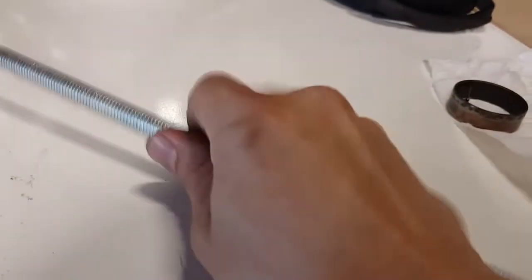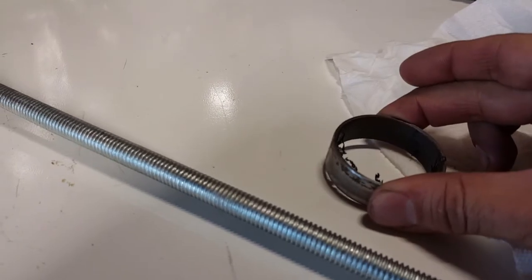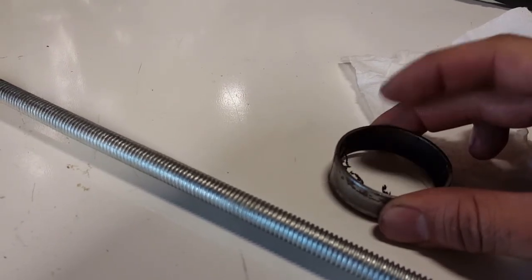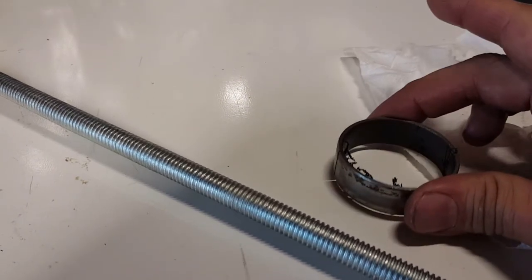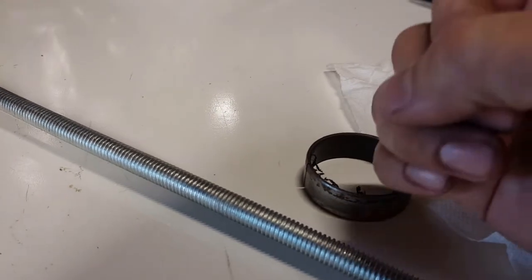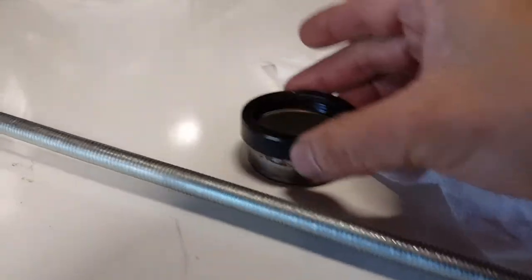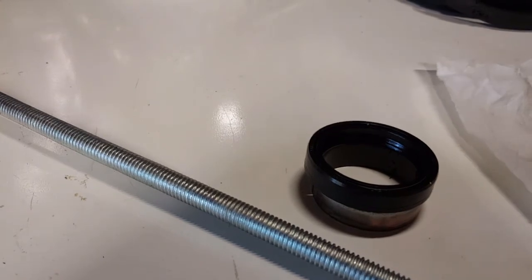But before you do that, you are going to have to stick a screwdriver in here or your fork tool and bring it up off the ring that's inside the gold tube. So you bring it up at an angle like that, and that's when you stick in your washer underneath this part. So you want to get it a decent size off so that it slides into place, and you just slide your tool in it and pull up. And this is pretty much how it sits inside your gold fork when you're replacing your seal.